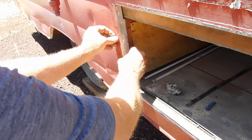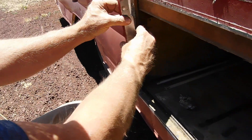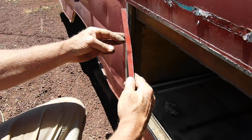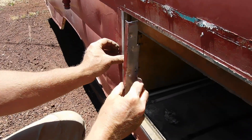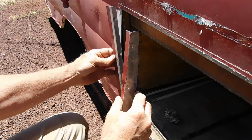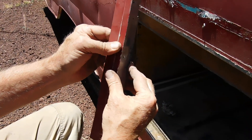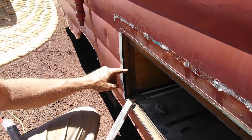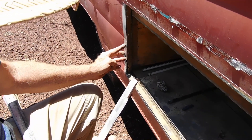Look at how clever this was — it's in here tight and I don't want to hurt it too bad pulling it back out. This is a one-and-a-half by a half-inch L. They did the same level notch there, then took the same material and reversed it, creating a very wide flange to protect this from getting moisture in it. A little moisture got in anyway, but we're going to put sealant behind this and adhesive to hold that down.